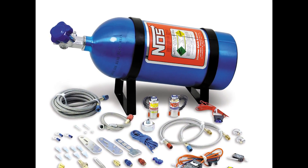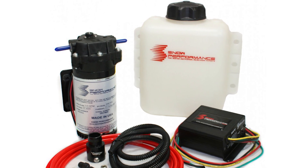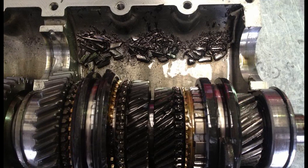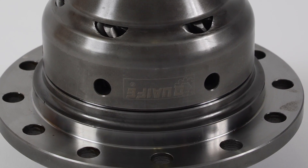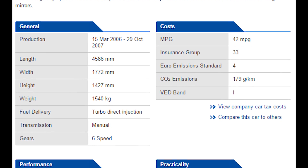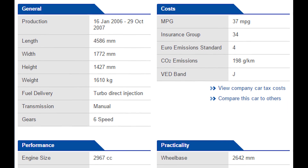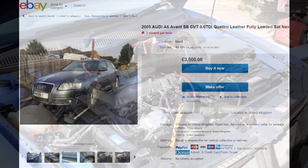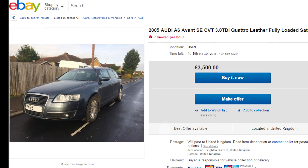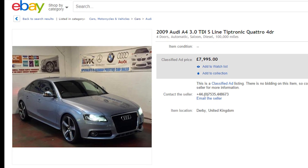To go beyond 250bhp you'd need even bigger turbos and could add things like nitrous injection, propane injection, or water-methanol kits at any point. But at that level on the same kind of car, you're probably tearing the gearbox apart and you'd need an LSD to put the power down without constantly breaking traction. To reach around 300 horsepower on a 1.9 TDI in a 1200 kilogram car, you're probably looking at four to five thousand pounds if not more. At that point it might make more sense to buy a more powerful stock car — like a 3-litre TDI — and take that to a similar or higher power level.